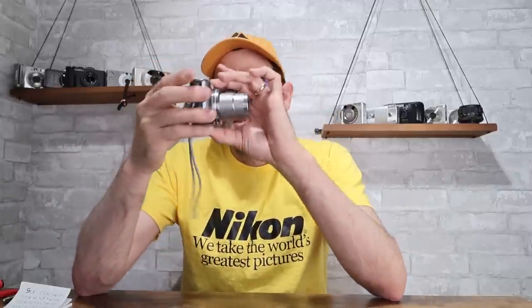Yeah, so the thing that I was going to say about Panasonic Lumix is, although I love these cameras, and at the company I used to work for, I was a buyer for an electronics company, so I worked with manufacturers to bring the product to our online store as well as 6 retail stores. The biggest thing, despite my love for Panasonic Lumix, is they often have sensor dust issues. So whenever you power it on and it just zooms out a little bit, you're like, oh, it takes pictures fine, and it does. But as you zoom out, the dust becomes more and more visible, and it affects the pictures. So it affects the value drastically.